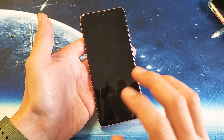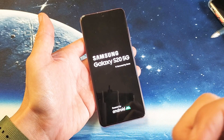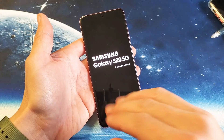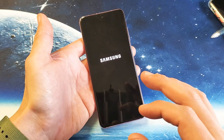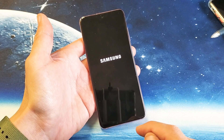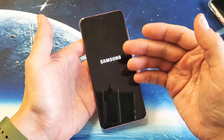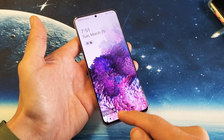Why do you want to go into safe mode? Well, maybe your phone is acting up — maybe it's restarting a few times per day, or maybe when you open up an app like the camera it freezes. If everything is fine in safe mode, then it's most likely one of the apps you downloaded. You'll need to start uninstalling downloaded apps to find the culprit.